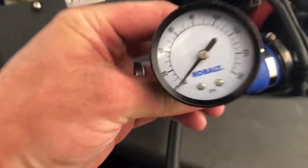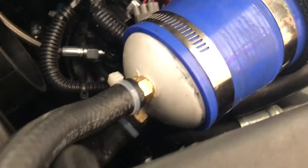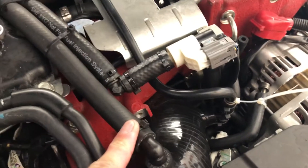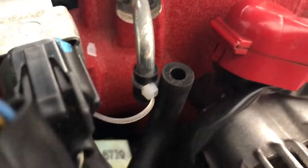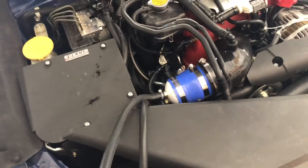Boost leak test showing zero. My setup: I'm plugged into the inlet. These are the valve cover crank vents which I've plugged at the end with a couple of bolts, tightened down. The PCV up here I capped, and the hose for that — another bolt through it. That's capped as well. The purge solenoid is removed and plugged there, and where it goes into the intake is capped with a screw as well. Showing zero psi — three hands to do this, so bear with me.